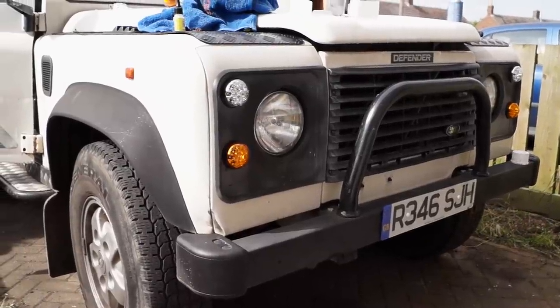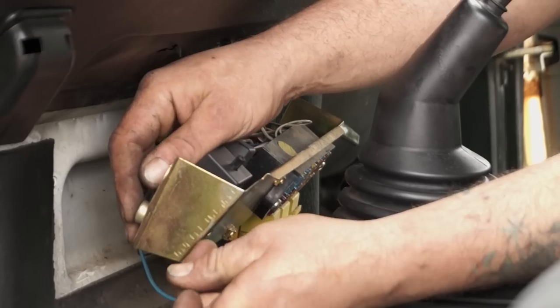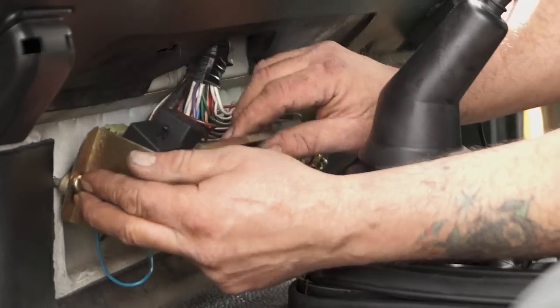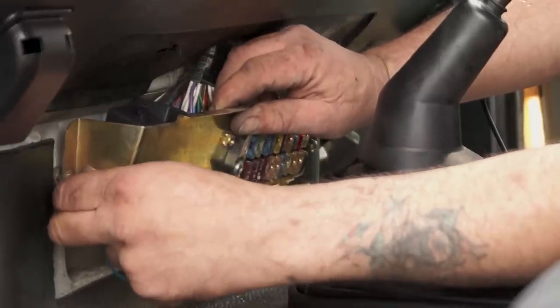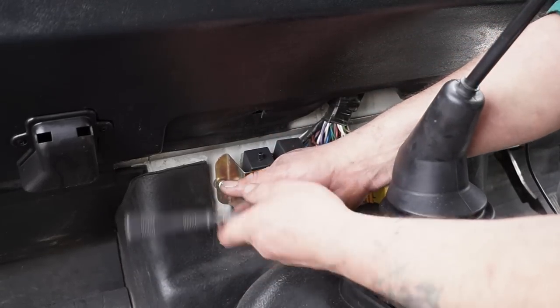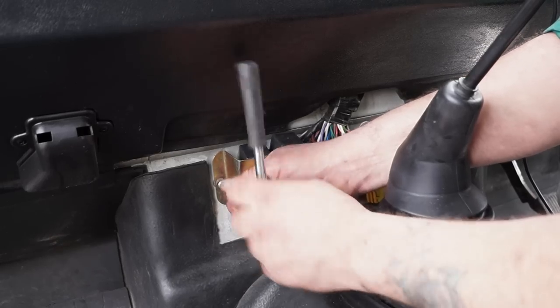So there we have it — we have LED lamps working. The last thing I'll tell you is make sure that with the bracket, you put the spacer back behind the bolt when you fit the fuse board and relay board back on the vehicle. This is just to make sure you don't crush the wires up against the bulkhead and cause shorts or push the wiring where it shouldn't go. It's not rocket science to fit these LED lights and they look very good at night — they're a lot more prominent than just a light bulb which can fail. I'll see you next time.